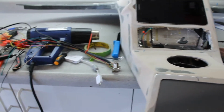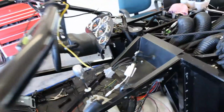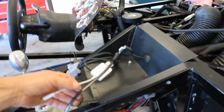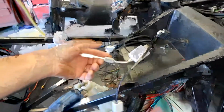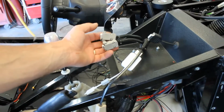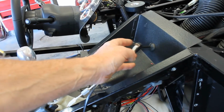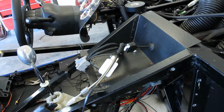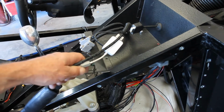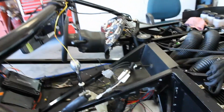So far so good. And there's my quick disconnect for the console. HDMI, 5 volt power. The 9 pin connectors. Traction control. So yeah, a lot of little stuff tidied up into a couple of small disconnects, so that's going to be cool.